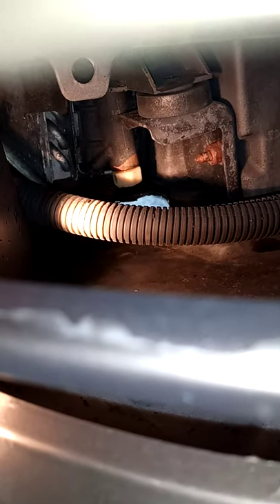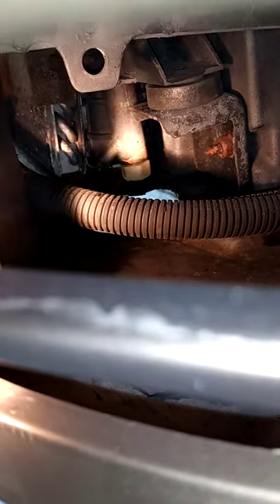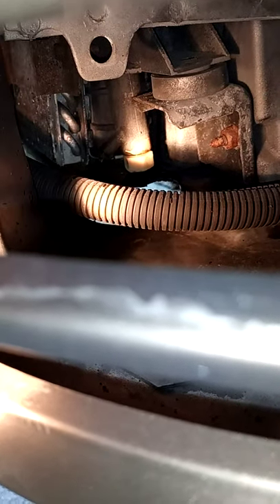So why is this a special trick and why should you care? There is a radiator drain plug in there — that kind of white plastic drain plug right there. The trick I'm going to show you allows you to save about a half hour of time, because I'll literally be able to reach up there with my hand and grab that plug. That's the purpose of the hole saw: used very carefully to cut an access hole.